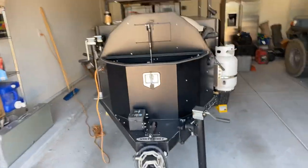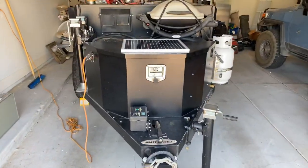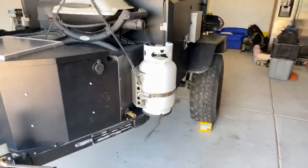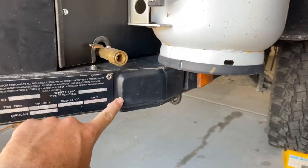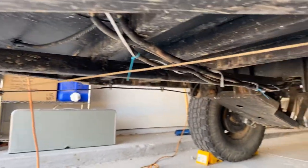All right, everybody. So we got the Smittybilt Scout here. This is highly modified, but I wanted to run you guys through it. We've had a bunch of people take a look at it when we're out camping and have asked if I've got a video because they want to take a look and maybe try to replicate it. I'm a huge proponent of the Smittybilt platform. They do a really good job. I know there have been some issues with cracking. We didn't experience anything, but just to be safe, we actually added some reinforcement brackets underneath, and then I welded a new center beam that goes all the way back to the main part of the frame.